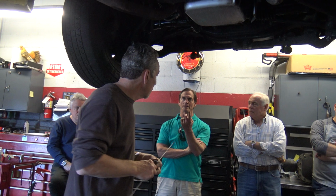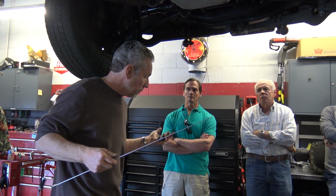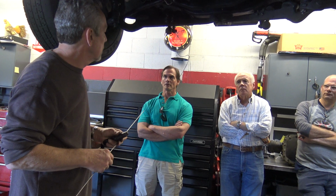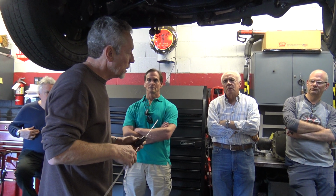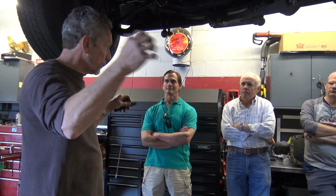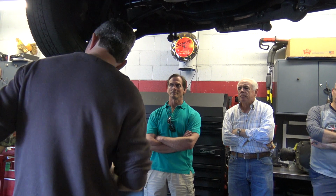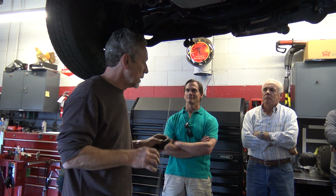And what's the maintenance on the tranny and the differential? That's a good question. I like to change the differential fluid on the major service, which usually is 2 years, 12,000 miles is what is recommended. What kind of oil? Just regular gear oil, regular 80, 90 weight. You can go up a little heavier if you have one that's a little noisy. One thing about the noise on these is that the rubber mounted differential, not only does it have those vibration dampeners on there, but the rubber mount absorbs a lot of the whine. When they came out with the mineral oil cars, they had a lot of differential whine problems, because it's not as soft mounted.